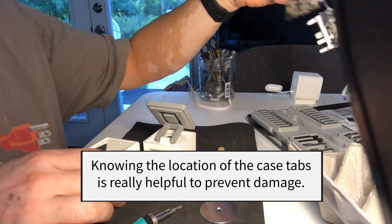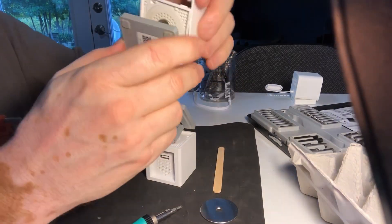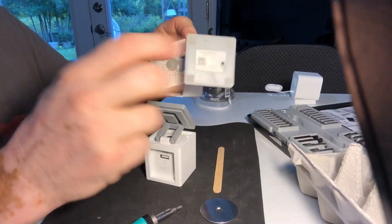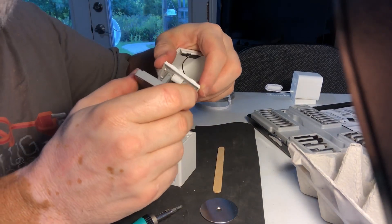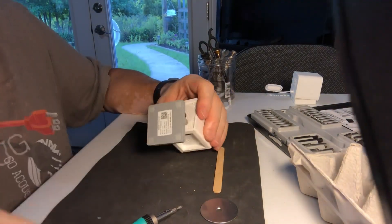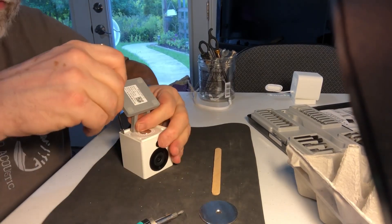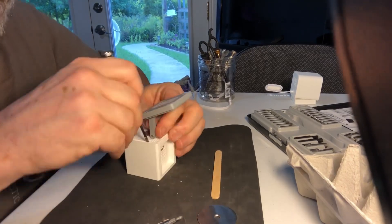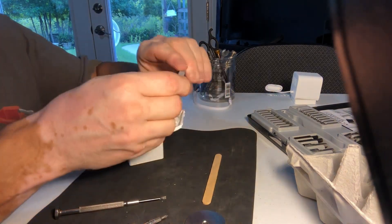Looking at this first camera — here is the bottom of the case. It has the two screws and then two mounting tabs on the opposite side of the screws. That's where we want to apply pressure to take this apart. We can work it out just a little bit, but it won't break free until we break this tab free. There we go — get that tab on the side. I can see where this one's had some water damage in there. We'll put the base aside.